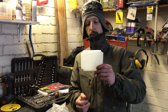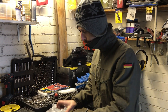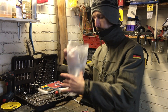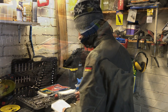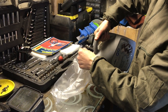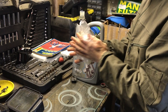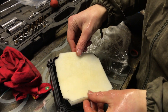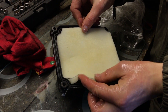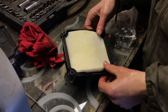I've got me festive beard starter pack and what we're going to do is bang some oil on that — well, oil in this bag — throw the filter in and give it a good smush around, then throw it back in the filter. There we are — that's the air filter element nicely oiled. It's got a light coating of oil, it's not dripping in any way, it's just enough to help catch any particles that go into the air filter. So we're going to put that back together and move on.